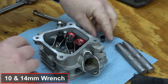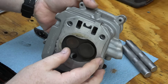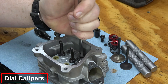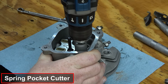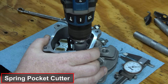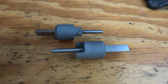We can now pull out the factory rockers from the Wildcat head and remove the springs, retainers, and keepers using our valve tool from rbgkarts.com — link in the video description. With the valves removed, we take a measurement of the stock spring pocket so we know how much we're going to be cutting. The proper way to do this is with a mill, but as long as you take your time with a drill and measure often you can do it with a simple hand drill. We're using EC Carburetor's spring seat cutters, available in 5mm and 5.5mm depending on your valve size — linked in the description.